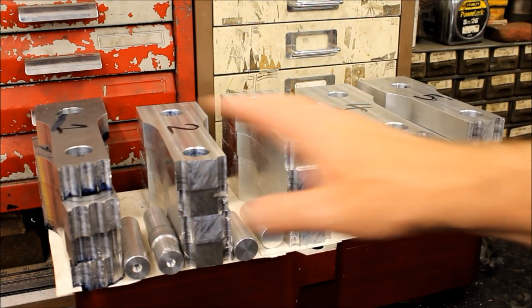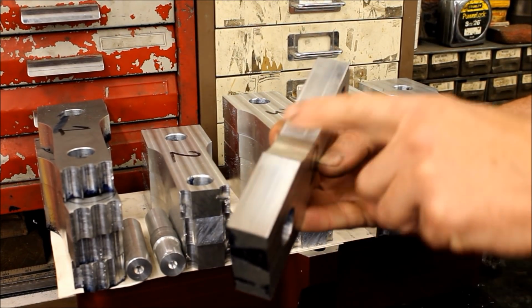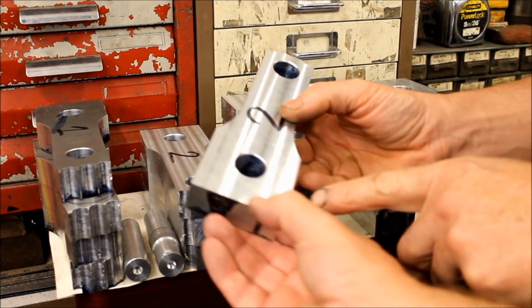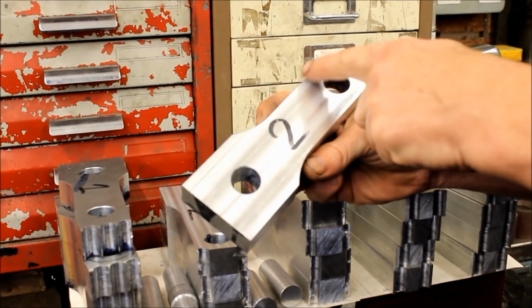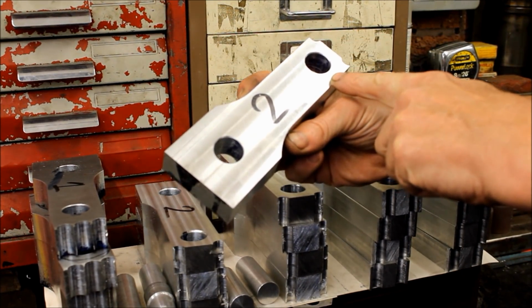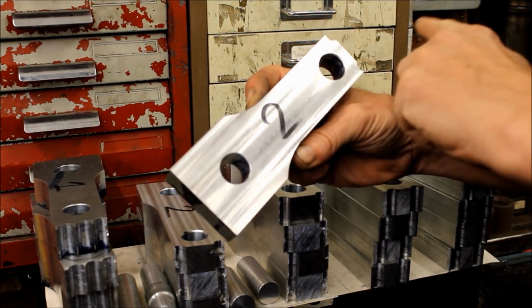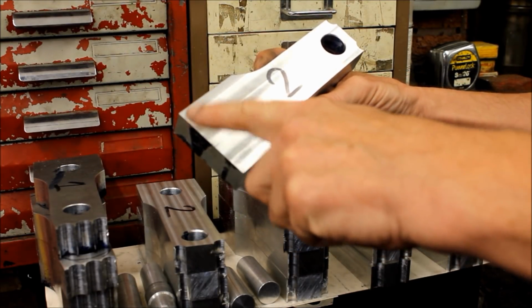So what's next with these? We've actually set them up with our 2 mandrels. We've cleaned up that edge. We've faced that up. The next step to do is obviously we need to mill round the end, the edge, the small end, and hopefully try and get it to blend in as perfectly as possible. We've got to mill the bottom off.